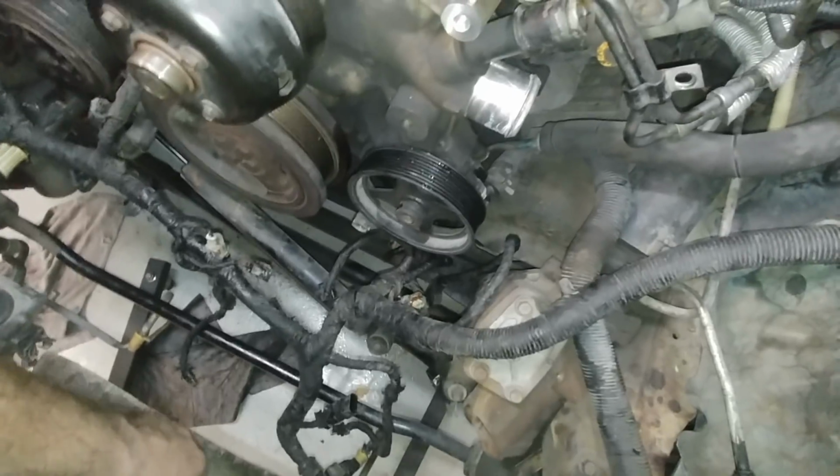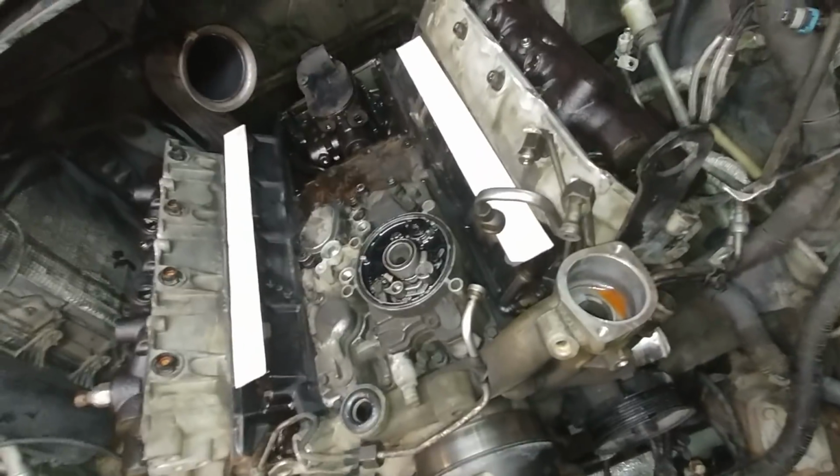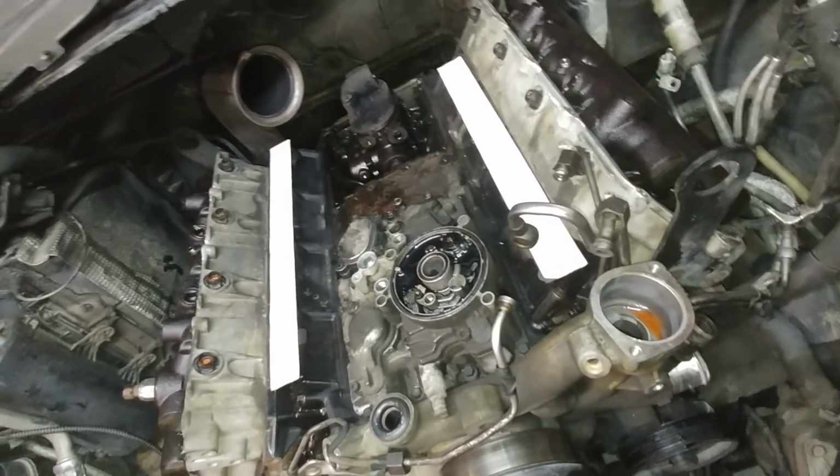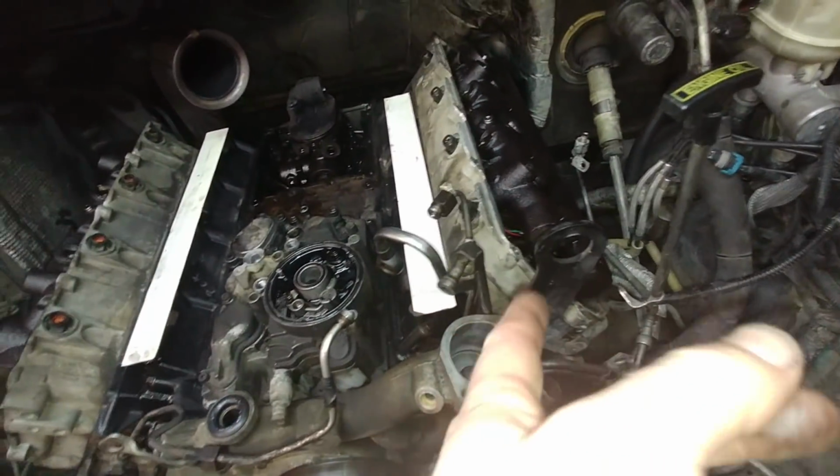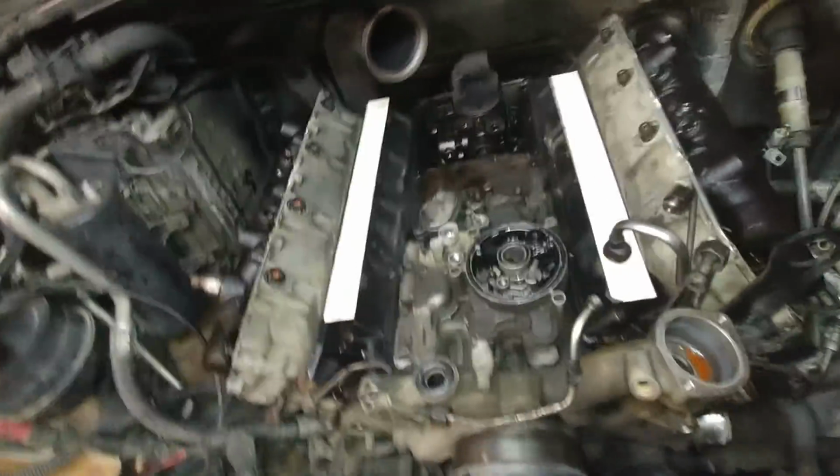I don't know how much I want to pick on the engine harness. You know, it's like a $650 part. Maybe we can not pick on it. I don't think we had any issues that said that it was bad. I would just route the cam sensor side over here behind the fuel lines. Clean out the MAP hose, clean out the EVP tube.